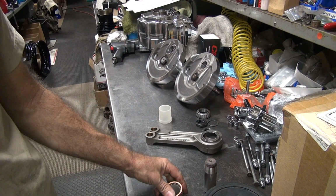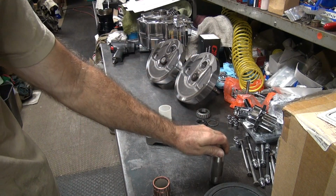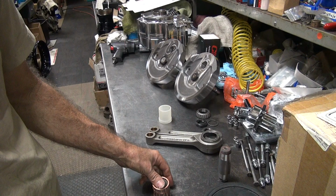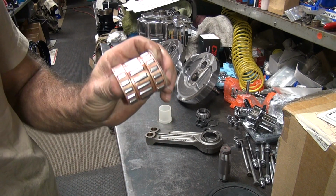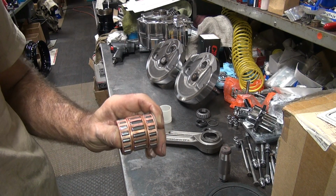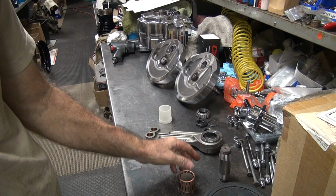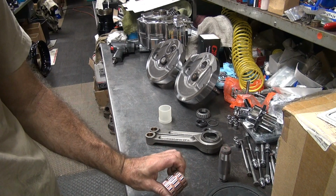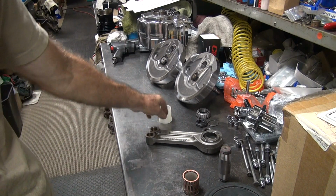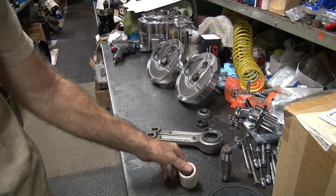So, there you go. We got 2 options. We need new bearings or a new crank pin. And even with the 1 thou over crank pin, we're going to be pushing on making that rod set clean up for what we need with these way undersized rollers. So, probably the better thing is to do a different bearing kit. But we'll see. All I know is what we got right now doesn't work. So more than likely I'll change out the bearings to something I can work with, because we need a lot bigger. Yeah, we'll see. Maybe we'll do the crank pin. Who knows? We'll see.